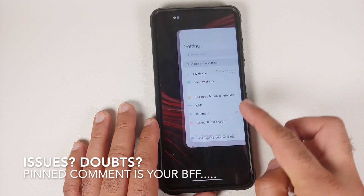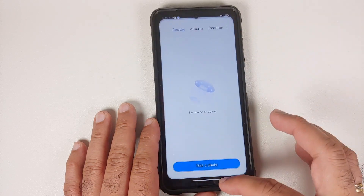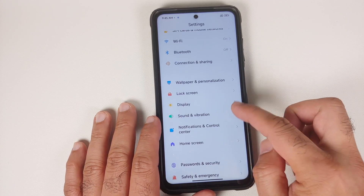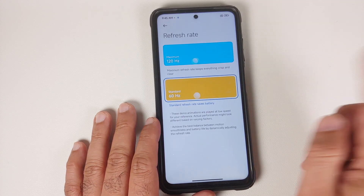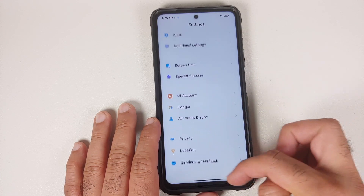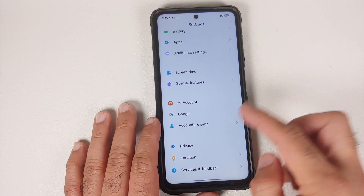What are the prerequisites for this video? You do need to have an unlocked bootloader and you need to have access to a computer. Unfortunately, at the time of recording this video, you cannot install Xiaomi EU ROM on your Poco X3 Pro based on MIUI 13 and Android 12 without having access to a computer. If and when this changes and we have a video with recovery, that will be linked in the description and in the pinned comment. How to unlock the bootloader — a video for that can also be found in the description.